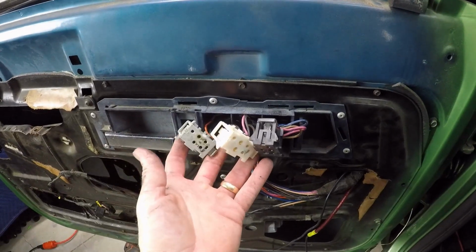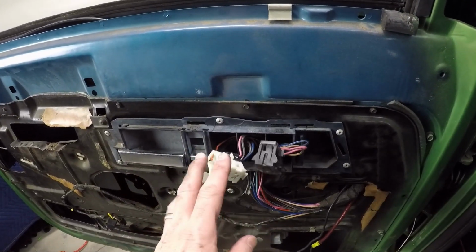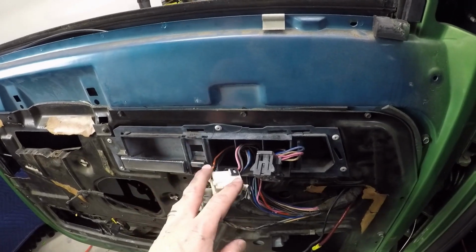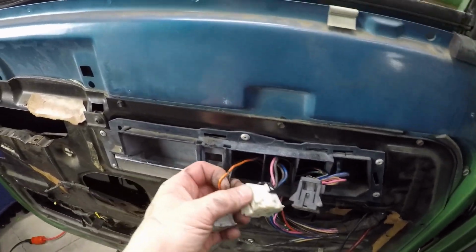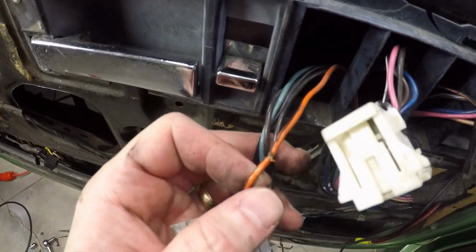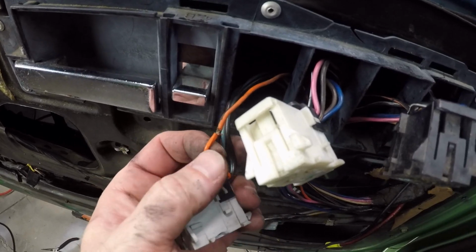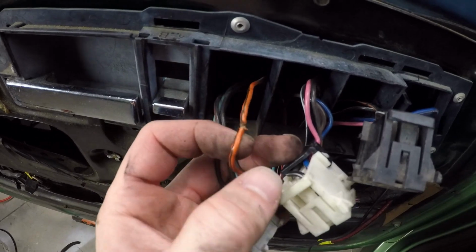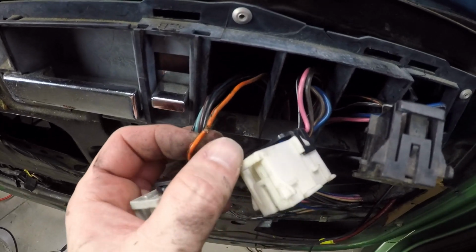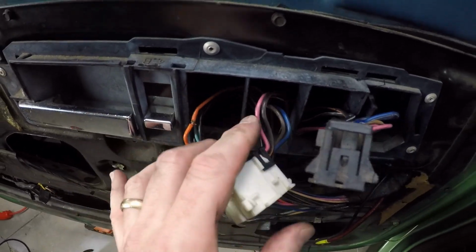So you don't have to take the wiring harness for the door lock and window up and down, for the door handle and the window switches, off to do what I'm doing, but the reason why I am is because I noticed this. When these solenoids were put in, somebody jumped things off of the wires back here. So we've got some possible shorts or wires that could become shorts or just degrade over time because they're open. And that's got to be repaired.